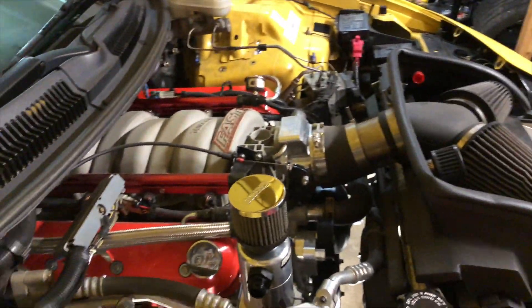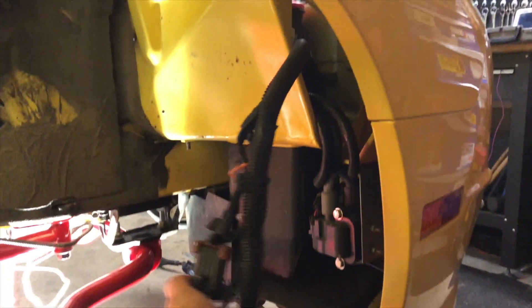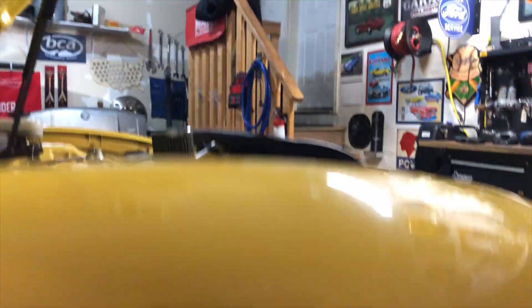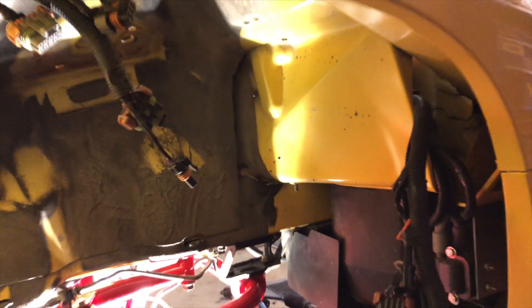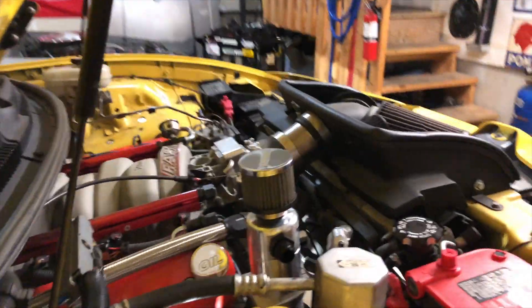Finally taking care of the wire tuck on this car. I've spent so much time detailing the engine bay, deleting things, relocating the coil packs into the bumper — that was a cool little mod I did. But this here is that ugly harness that runs over the top of the fender. You just run it through the side panel here, cut a hole over here, put these guys up and pin them up. Put your inner fender back in and slowly work away getting all this back together, hopefully get on the road when the weather starts getting nice again.